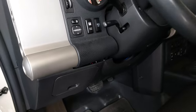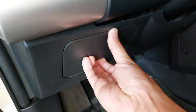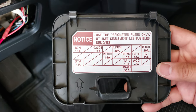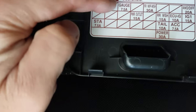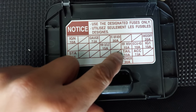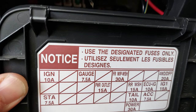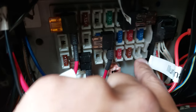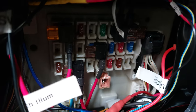I'm here inside my FJ now and I'm going to find the fuse block — here it is. I'm going to open this up and take a look at the diagram. Right now I'm looking for things that might be illuminated whenever we turn on the headlights. The first thing I see is the gauge and the tail light — whenever we turn on the headlights, the tail lights also turn on. The tail light fuse is three over from the right on the bottom and it's a 10-amp fuse — one, two, three — this is our 10-amp fuse for the tail light.